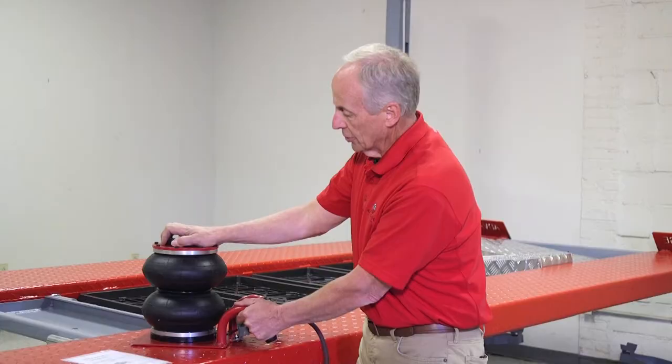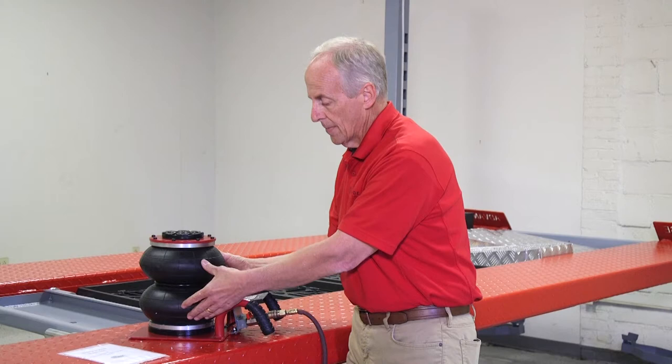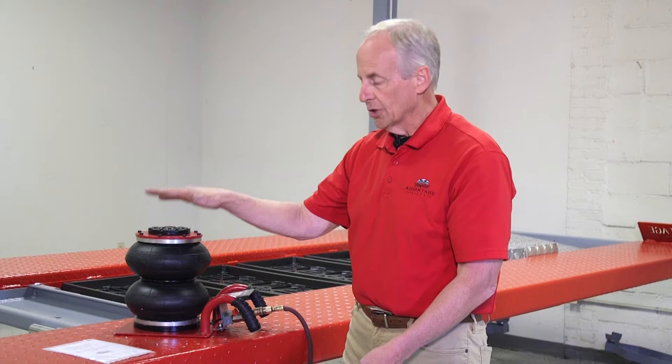You've got stability and you're not just resting on air. This jack is not designed to go halfway up because at that point the stack cups are not fully extended and locked, so you will get a little wiggle — and that's what people don't like. When you use this jack, it's all the way down or all the way up. It only raises seven inches, so it's not going to raise the car too high.